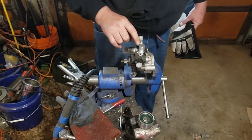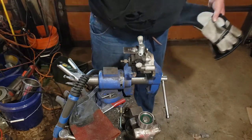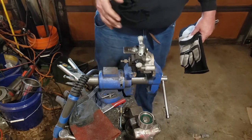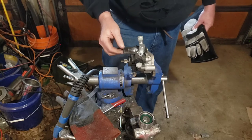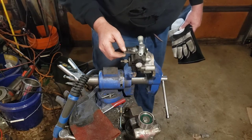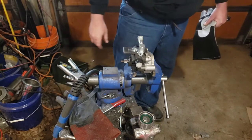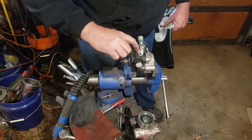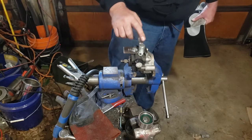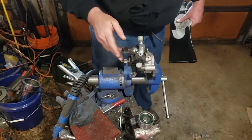If I am going to destroy it, it's just going to be knocking seals and stuff out of it, simply because of the fact that this is getting hot. So I'm getting ready to use the YesWelder 250 again. It's my go-to welder pretty much — it's just so easy to use. I love the manual settings mode. I've got it turned down to 1/8 inch steel because this is slightly thinner than 1/8, but this piece is a little thicker, so this should be fine. I've got .035 wire, so I'm at 20 and 6.1. We're going to see how that works. If it's a little cold I'll turn the heat up. I'm going to try to bridge that and weld this around the edge so that this doesn't crack away and start leaking, because this is controlling the steering completely — there's no mechanical link after this.